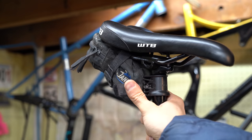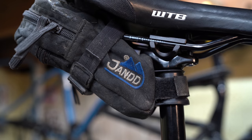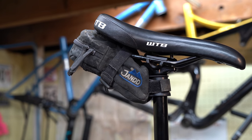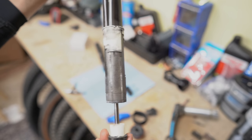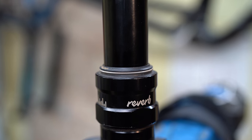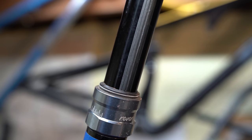So what are these little things made for mostly? They were designed for those little saddle packs — the ones that fit a tube, a tool, perhaps a CO2. You might ask why you'd need something like this for a small seat pack. The answer is that stanchions are vulnerable to scratches, and once you get scratches, dirt gets in and makes it inside the dropper post, making it more prone to failing or needing service. You might think to wrap silicone tape or a rubber shim around the stanchion — that can work — but the main dust wiper seal at the bottom of the dropper post could get damaged, letting in dirt and grime. The Valet is designed in a way that does not damage the wiper seal.